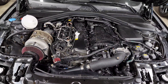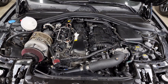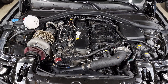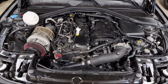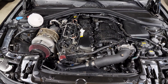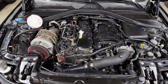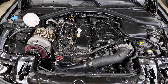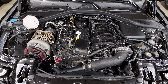I sent my oil out for analysis last year and posted a video about it. Even though I ran full E85 for a period of time, I found there was no excessive fuel dilution in my oil - it hadn't broken down and there weren't really any issues. For your specific situation, do your own tests and send your oil out to make sure you're doing the right frequency. E85 is a lot of fun - just do your due diligence, pay attention to the system, and if your car is misfiring or throwing codes, address it. This is a great platform to take advantage of E85.